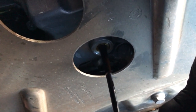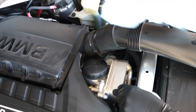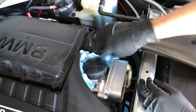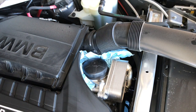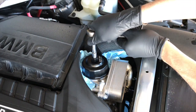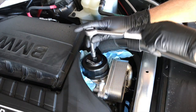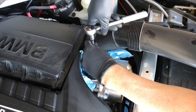While the oil is draining, we're going to go up and change the filter. When doing the top filter, even though it's easy, I like to fill the area with some rags and have things ready because it can be messy. As you can see, that special oil filter adapter fits on perfectly. As you get close to getting it off, you may get a little dribble — hopefully not.